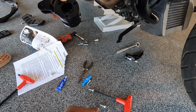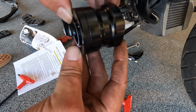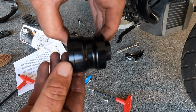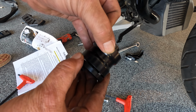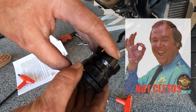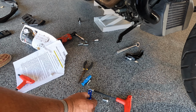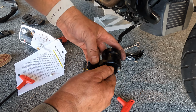But these three screws came out. Now I'm gonna put blue Loctite on it. On here, there's little markings. One, two, three. Three being the lowest. And on the clevis, there's a marking there as well, knowing that you're lined up. You'll know you're lined up because the holes will line up. So let's finger tighten these bad boys. And three.